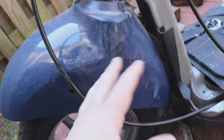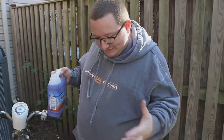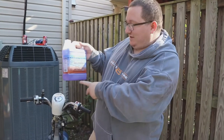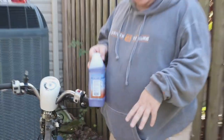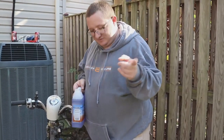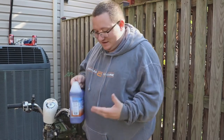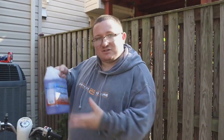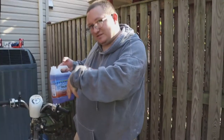We're going to go ahead and clean all of this dust from grinding and cutting off. We got everything plumbed up, everything seems good, tight, ready to go. We do need to adjust the brake. This is actual high-performance engine coolant meant for scooters — specifically this mix. There's way more than we need inside of this, so we're going to drain the coolant that's in the bike now because the stuff that's in there, if you remember a couple episodes ago, is all engine coolant for a car — higher heat, all of that stuff. This is meant for a scooter because it's not as strong a mix with the glycol and everything else. Now we're going to drain this out while we wait for the gasket for our exhaust to seal up, and then start it for the first time.